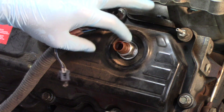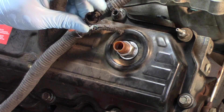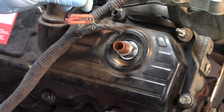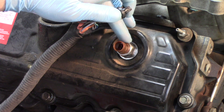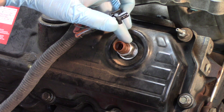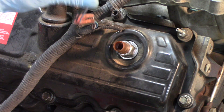What you don't want is to put a new ICP in and have any type of wear or corrosion built up on the pigtail, or oil or moisture inside those terminals, because that could cause problems on the new ICP or show a false negative as a problem with the ICP after the repair is done — causing the technician to go back through, do another diagnostic, possibly change the ICP a second time, before they finally decide to do the pigtail and that resolves the issue.